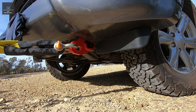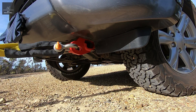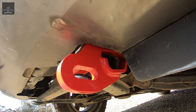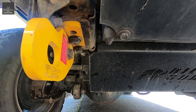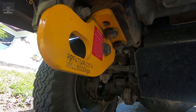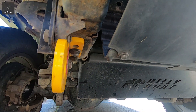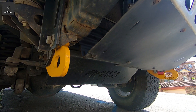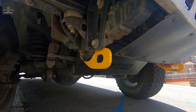For example, this ARB recovery point allows for angles of pull up to the maximum turn of the front wheels. Some recovery points use 10mm steel, while others use much thicker steel, like this point. Have a look at the recovery points on this Nissan Patrol — they are approximately 10mm thick, rated at 5 tonnes each, but only in a straight line pull. If you were to use these on an angle, you risk damaging the recovery point or even the vehicle chassis. Regardless, these recovery points are still very strong when used properly and are much better and safer than using the factory hooks or tow points.